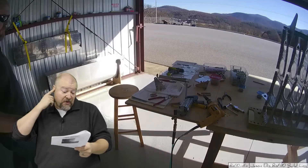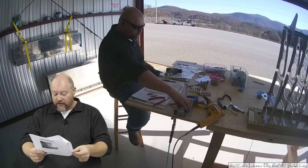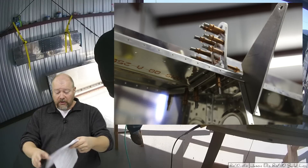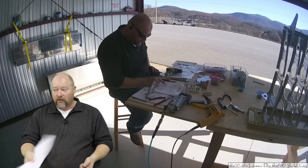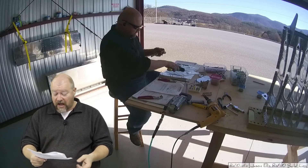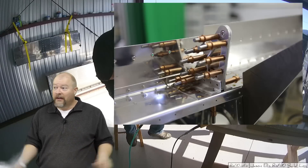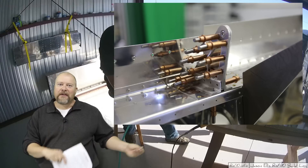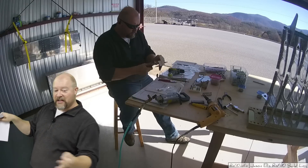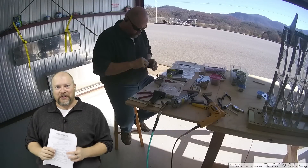The only other thing I'm curious about is there's kind of a small doubler that goes on the backside of the aileron rear spar. It's not just a thicker plate — it's actually made of this thick angle stuff and I don't really know what the point of it is. I'm sure it serves a purpose. I'm going to implement it as it says and then get back on track on the wings. I'm glad I had to do this now as opposed to later when I had a fully flying airplane, because getting up underneath your aircraft to make this fix probably sucks. Doing this with the wings off is definitely the way to go.